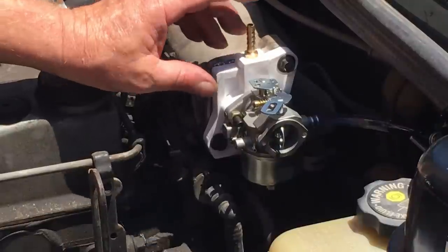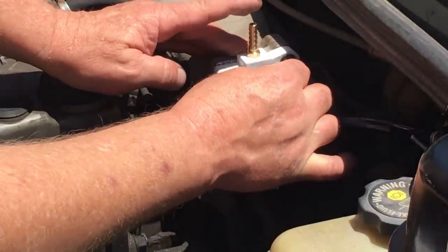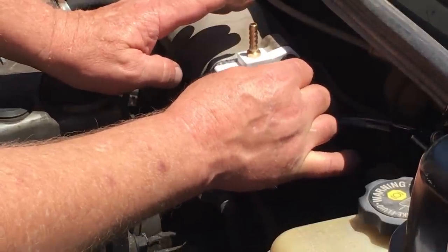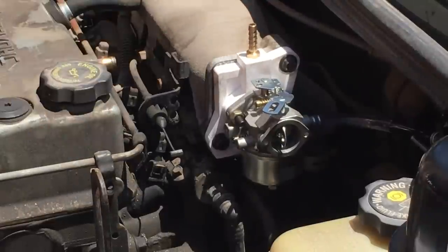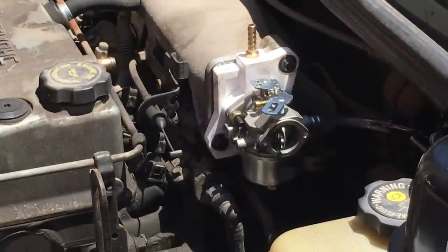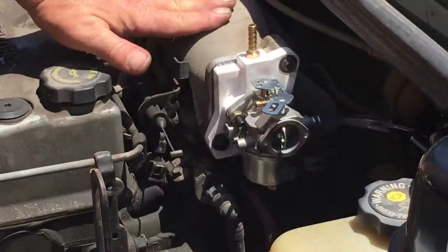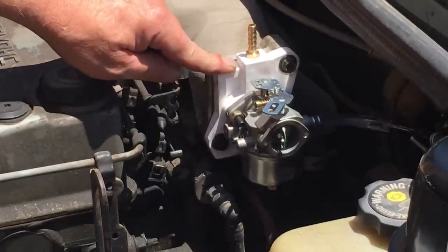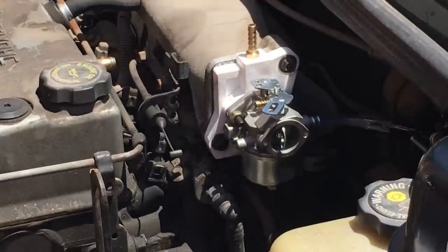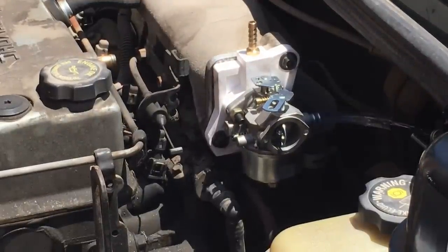The air bleed thingy makes a big difference at idle. Now, I'm not sure if this thing's helping or hurting. I'll try blocking it off and see what happens. The intake manifold's getting hot, but the 3D printed PLA adapter is staying cool for now. So I'm calling this a success as far as getting the engine to run without the fuel injection system working. And to top it off, the car runs pretty damn good.